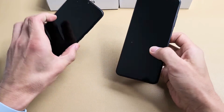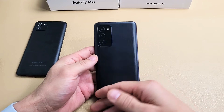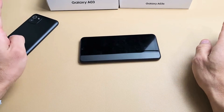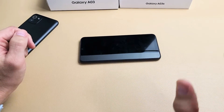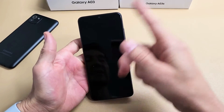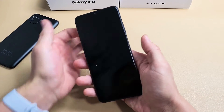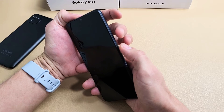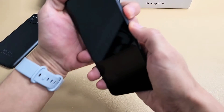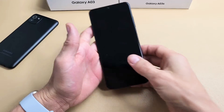If you're still stuck in a boot loop, the next thing is what I call the freezer method. Grab your phone with no case and put it in your freezer for 15 minutes. After 15 minutes, take your nice cold phone, tap the power button, and see if you're out of the boot loop. If it's still in a boot loop while it's cold, press and hold Volume Down and Power until you see a Samsung logo appear, then let go. Hopefully you are up and running.